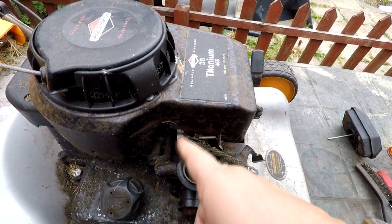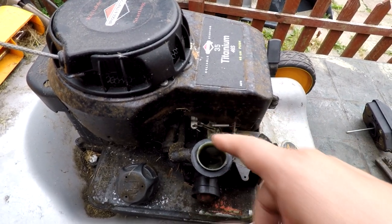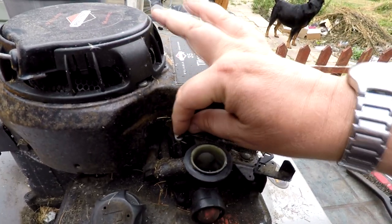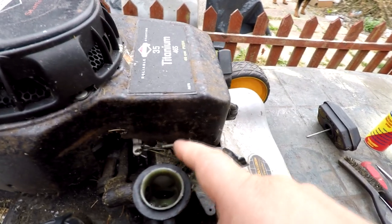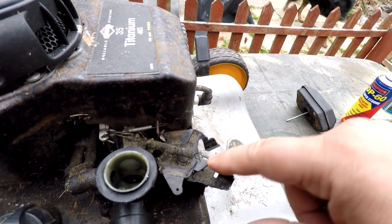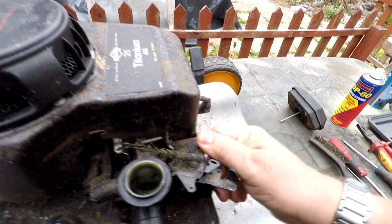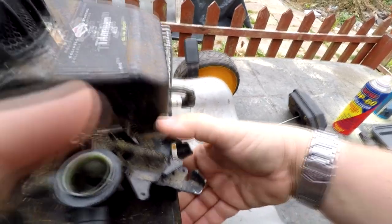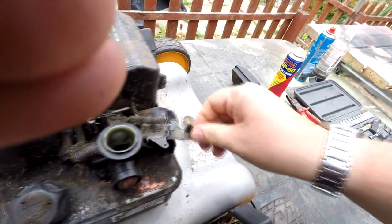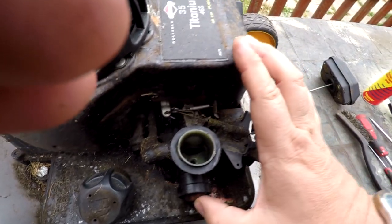Looking at the carb, the springs are all okay. As you can see, the springs are connected correctly. There's the little governor vane there which is moving freely. You've got the little spring and the big spring - both connect to that little clip on top of the governor arm vane. The little spring connects to this little arm, and the big spring connects to the part that moves up and down. A lot of people bend these, but you can straighten them back by bending down again.